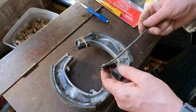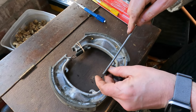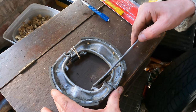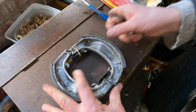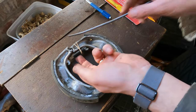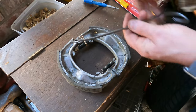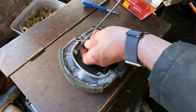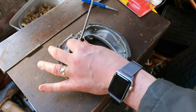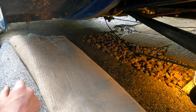Carrying it over to the car with the spring already loaded in — looks like I've got it the right way around. The tool goes on there and we pop that one on. It won't go quite as easy as that in practice with the hub in the way, but essentially we'll use the tool on the lower spring and then put the drum back on.